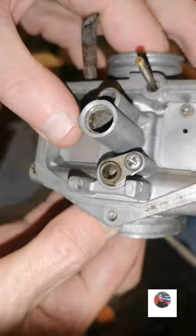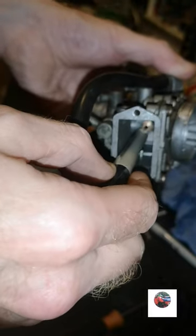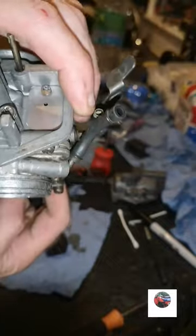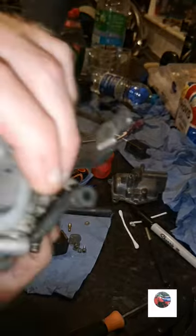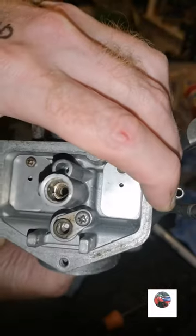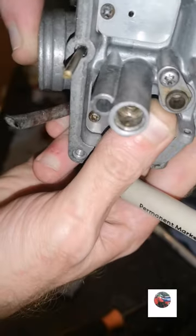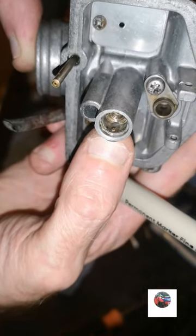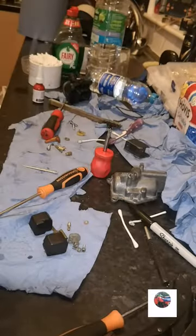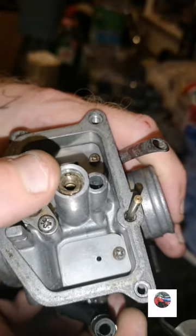And there, just push it up there, it should be alright. Just get some plastic, not metal, just to push onto the top of the emulsion pipe, just so we can get it up because it gets stiff. But it's all lined up. See the notch, it's going to line up with the groove, so I'll just push that on. That's it pushed on, it's over the lip there, you can see.